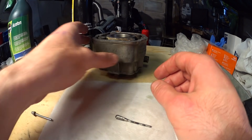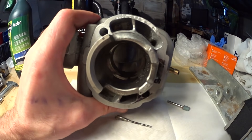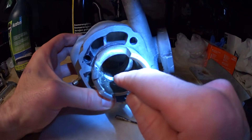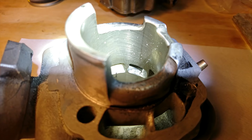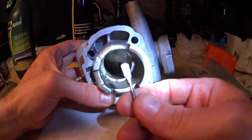If you don't do this, you might chip off the coating, which has happened here — I'll try to show you. So between those two ports you can see that the Nikasil has almost chipped off completely, because these tips will grab and do that.